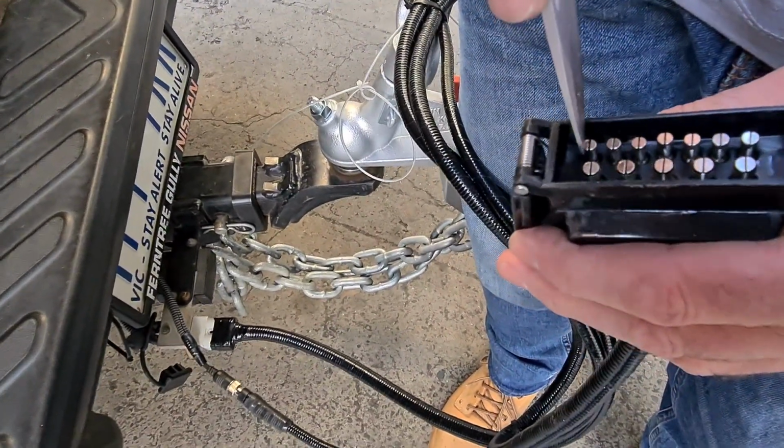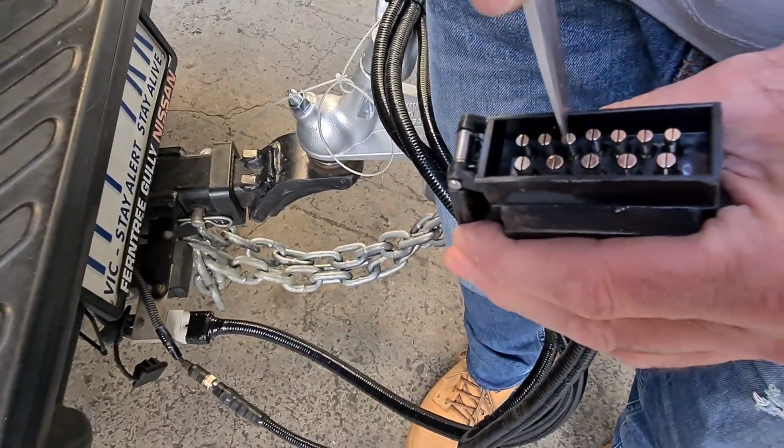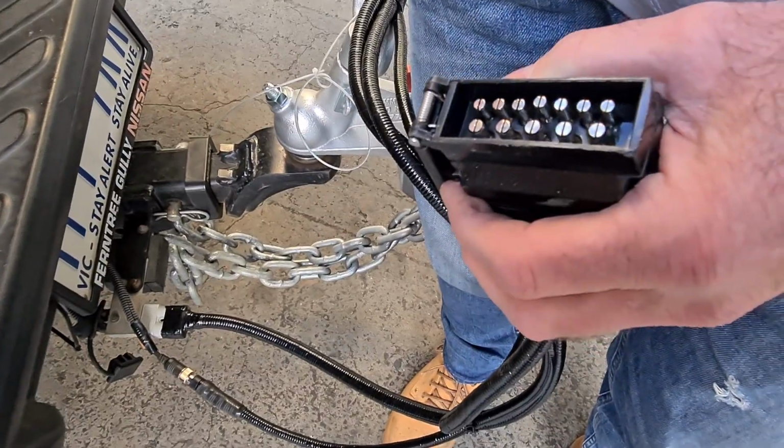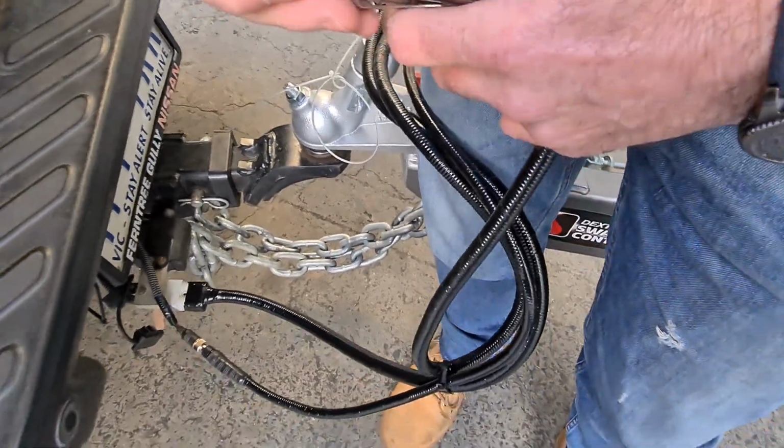Normally, 9 times out of 10, if you've got one of the lights not working, by just opening up the pin just that fraction, you'll find that you'll fix your problem and your lights will all be working. So that's a little tip for you.